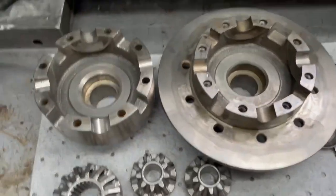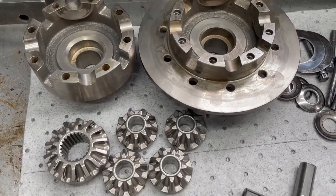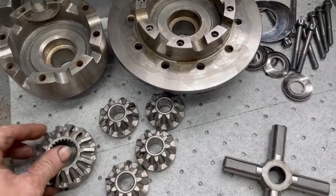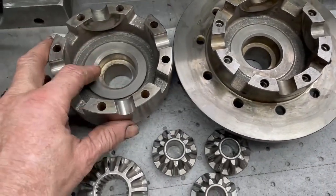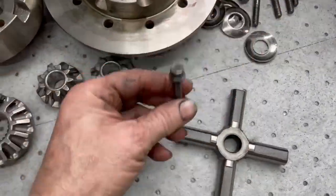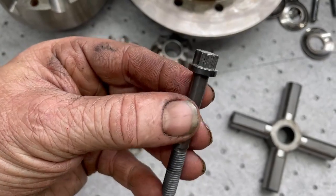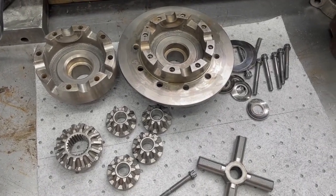A little more information about these short nose casings — they started off in P38s and ended up in the back of 110s when the Salisbury was taken away. Sometimes these gears have shims on the back, sometimes they don't. The ones that don't will basically chew into the casing like you wouldn't believe and turn them into scrap. This is one of the later ones — it still had the silly cross-shafted pins. On the early ones the bolts are only 10.9 grade and they break. Land Rover on the later ones put 12.9s, and we will reuse these because they're fine. We're going to put this together and move it towards being a half decent short nose diff rebuild.